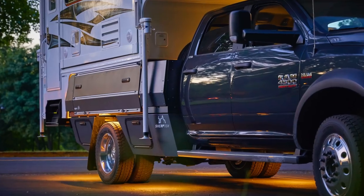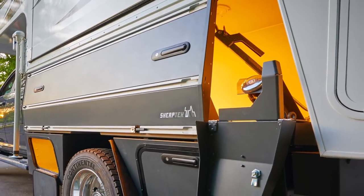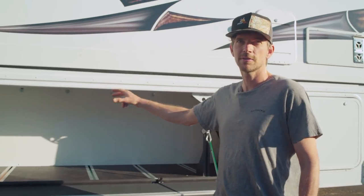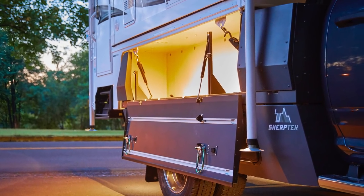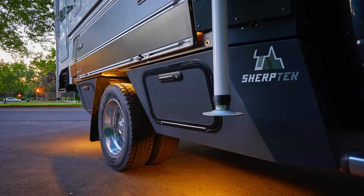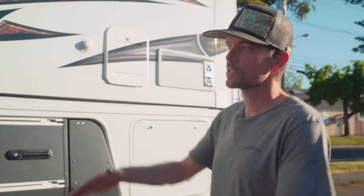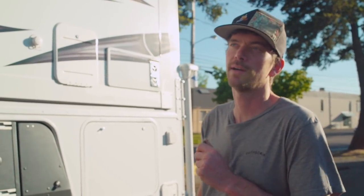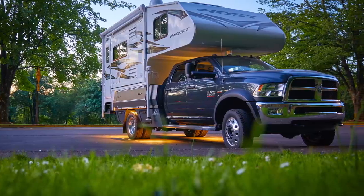This bed was ordered with our custom lighting system. We spec high-CRI photography and artist-grade LEDs at a nice warm spectrum so as not to blind your night vision. They're all controlled via a wireless RF remote. We embed a system on the camper to light up your storage boxes at night, powered by the camper. The full system includes lights inside the boxes that turn on when you open the door, and ground lighting under the boxes and wheel wells to light up the ground at night. All those lights are powered off the truck, so when you separate the camper this remote still actuates both sets of lights — giving a really nice camp ambiance with no connectors to undo. They're separate systems all running off the same receivers.